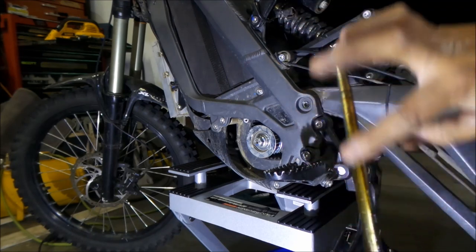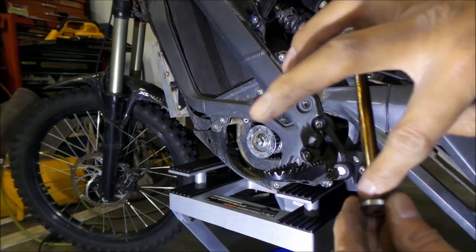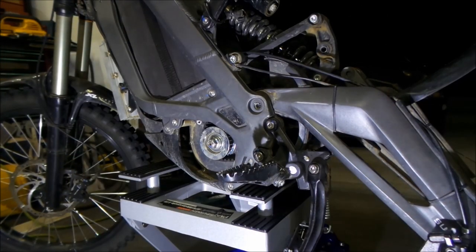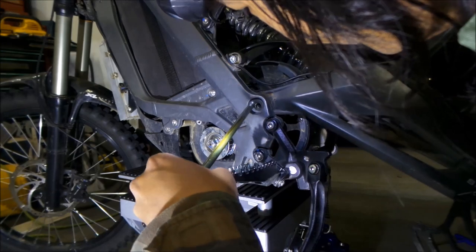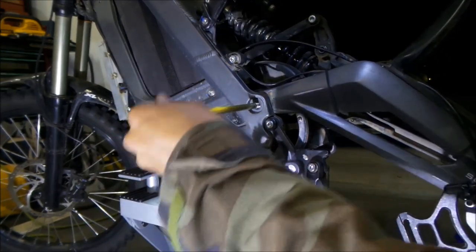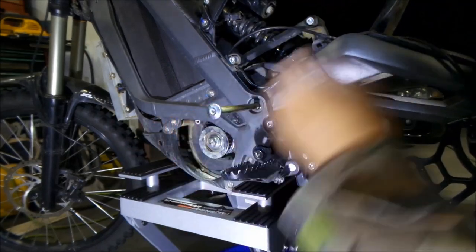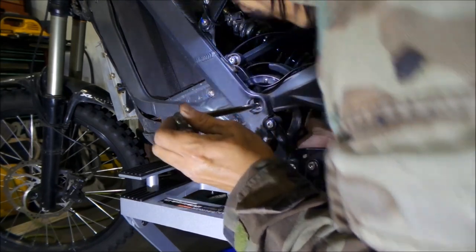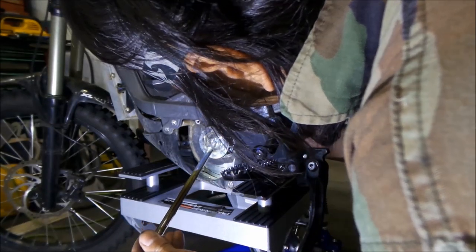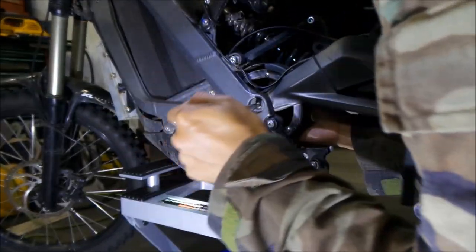Put a light coat on it - you're probably going to push a lot of it out the other end. I just greased the axle. Be very careful not to get any dirt on it, because the dirt will get in there. Line up your swing arm to the hole in the frame, but don't push it in all the way yet because it won't go in. Now you've got to line up your jack shaft. It kind of helps if you look through the hole first. It's a real challenge getting all this stuff lined up - everything is precise.